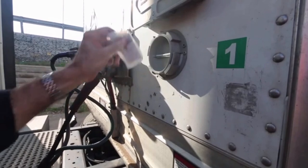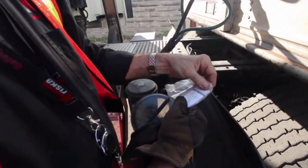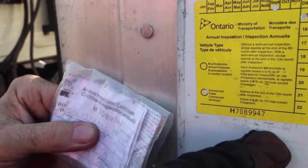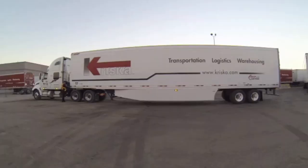Have a look at your preventative maintenance sticker to make sure the trailer is not due for preventative maintenance. Check your annual safety sticker on the trailer to make sure it's current. Check the trailer documents and make sure they're current and the safety paperwork matches. If the safety sticker is not current, if it's expired, do not move the trailer — report it immediately.